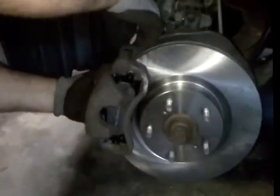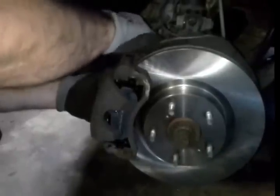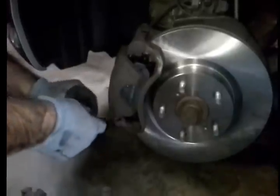Take these, just kind of sitting there. Now guys, when you get in your car, do not just take off. You're going to have to hit the brakes a couple times and let them get reset, because you will not have any brakes after compressing that. Just thought I'd throw that out there.